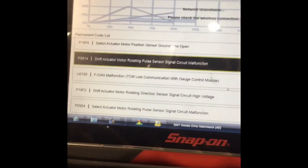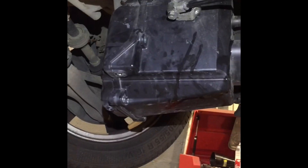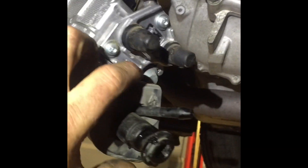I don't believe it's something to do with the clutch itself — I think it's inside this module. The F-CAN is kind of like a CAN bus. I'm losing communication intermittently — I have communication now and in a minute or so it'll lose it, then I get back in. The wires are going in from the top of that box underneath the battery. I'm dismantling the box — about five, six, seven, eight bolts. The transmission control module is not just the motors on top of the gearbox — it's separate.